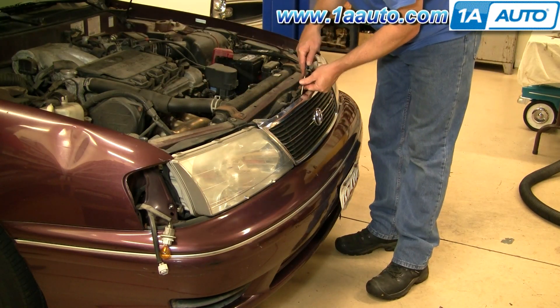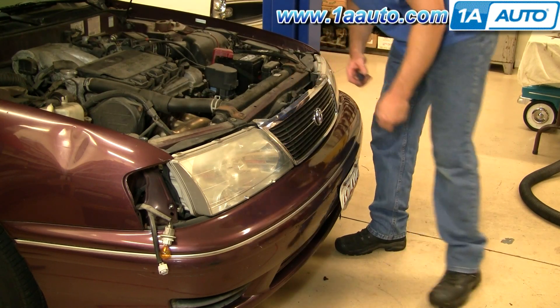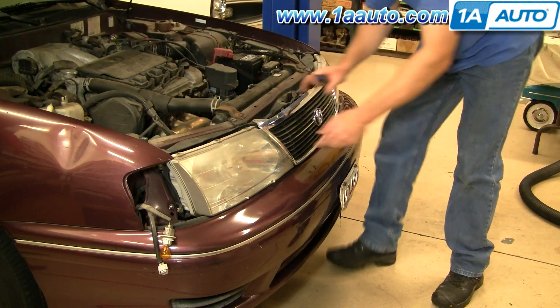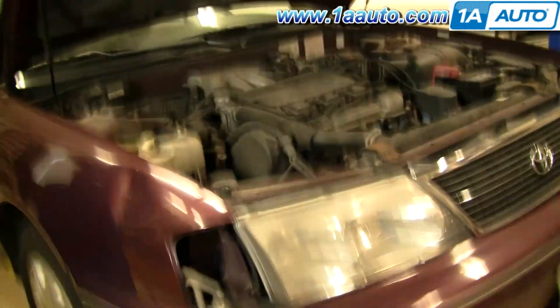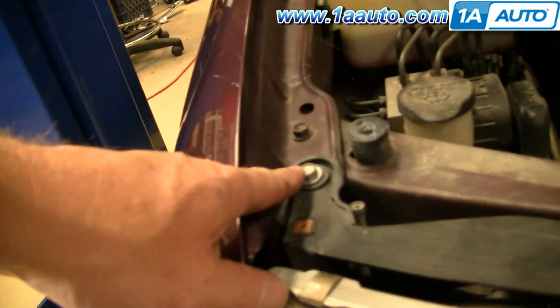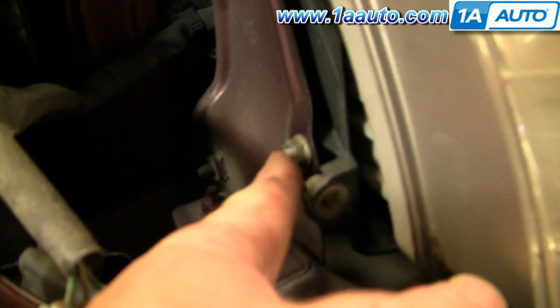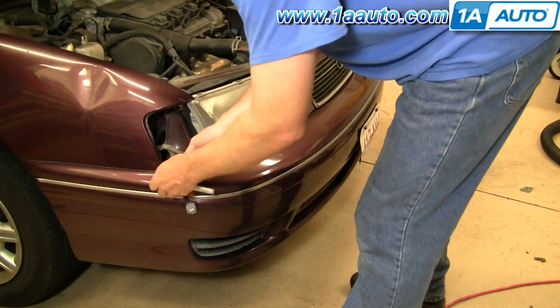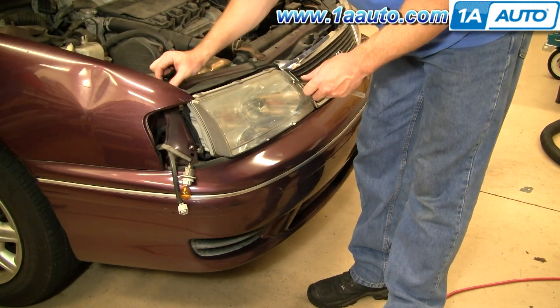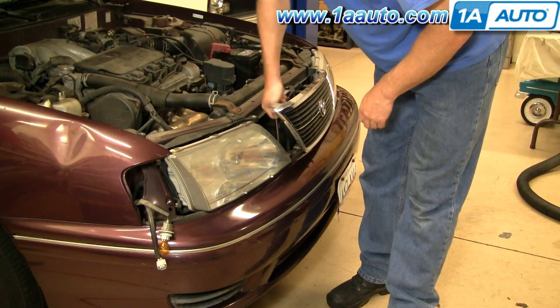There's a little clip here. Push the center in, and then use a flat-like screwdriver or your fingers. Pull the clip out, and that just allows the grill to kind of come up and out. There are four fasteners that hold the headlight: two bolts up top that are easy to see — one there, one there — a nut on the side behind the parking light, and finally a bolt in behind the grill right there. I'm just going to fast forward as I use a 10-millimeter socket with a ratchet and extension and remove those four fasteners.